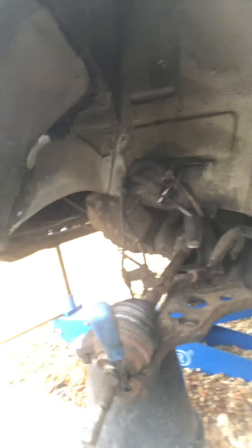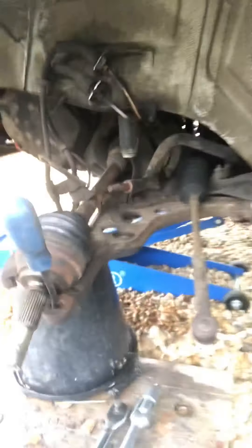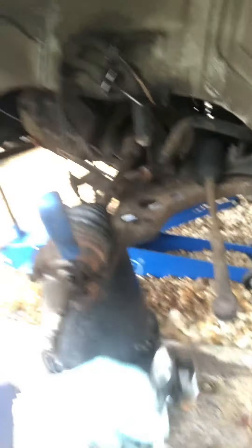It failed MOT on a few things. One was the suspension — the struts needed replacing so I've taken them out, and also the wheel bearing, so I've taken the actual knuckle and hub off and taken those to a shop so they can press them out. It's not really a job you want to do without a proper hydraulic press. So today what I'm going to focus on is one of the advisories: these link bars.